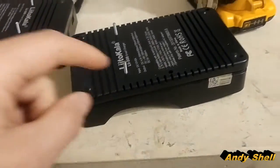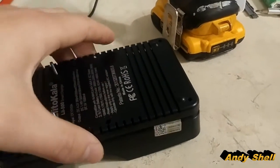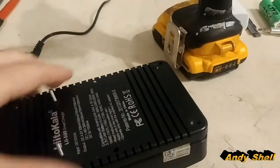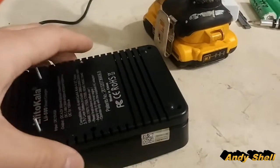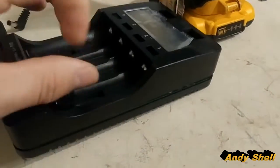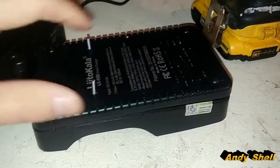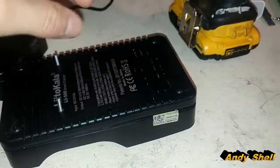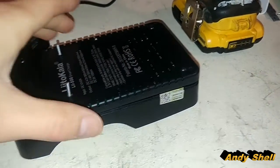When you're screwing the screws back in on this back plate, make sure you just go finger tight on the screws. Do not wrench them down because it breaks really easily — at this top corner it just shattered right off. When you're screwing the back plate on, just finger tight: once it starts giving you resistance, that's good enough. It doesn't need to be super tight.